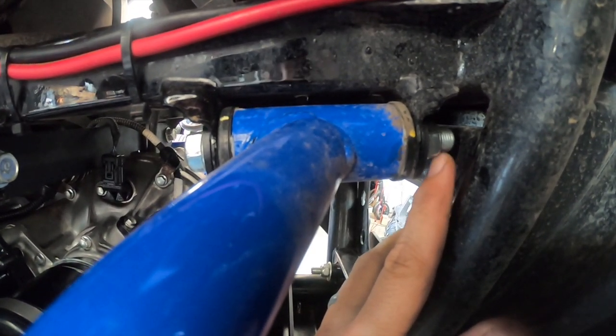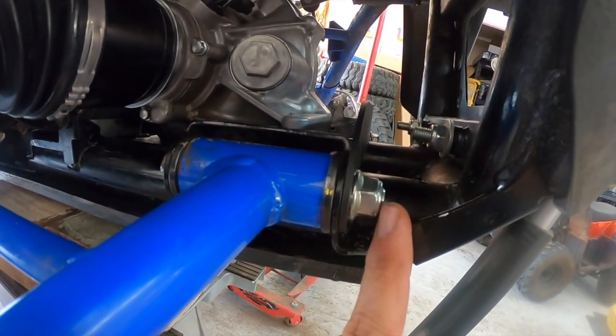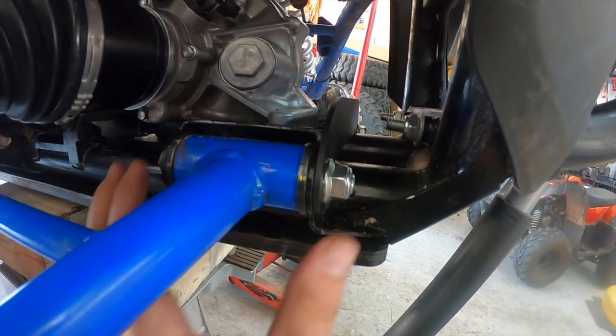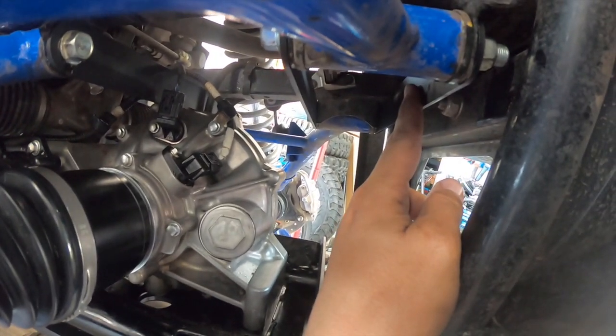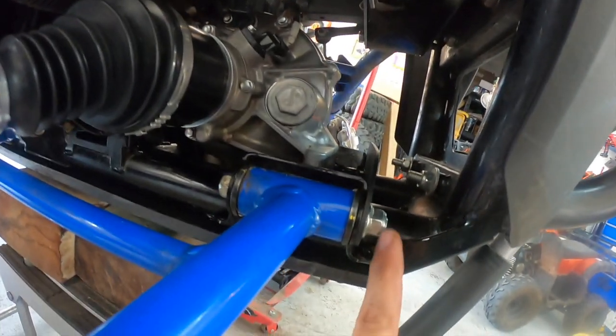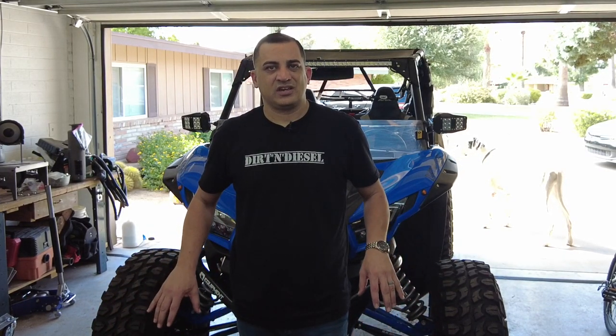Here's a quick look after it's installed. As you can see, these upper replacement bolts — you've got five, six threads there, nice and tight. But on this rear bolt and this bolt here, you only have about one to one and a half threads. These are torqued down and I do have weight on the suspension. If you order Brute Performance's non-heavy hitter kit, it comes with just one of these — you could actually do it without even taking the shocks off, just take the nuts off each one while it's on the ground, slide the brace on, put the nut back on. It could be an easy 10-minute install. This install with the heavy hitter kit from Brute Performance is 20–25 minutes. You really don't need to take the wheels off. If you got the standard kit with only two braces, 10 minutes to install it — you don't have to take anything off, adjust the shocks, or jack it up.